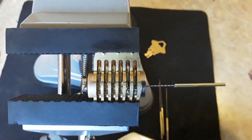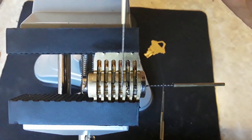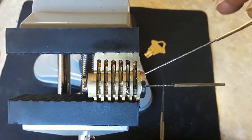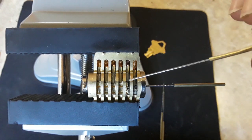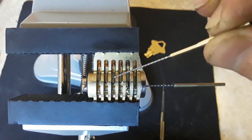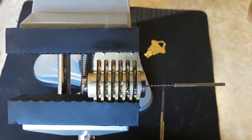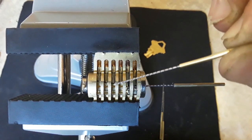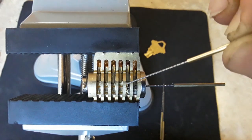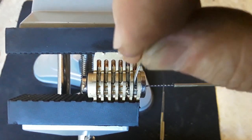This is very, very difficult to pull out. You can see right here we have a pin that has dropped down — we're going to have to deal with that. Right now we're just going to try to pull this back that little bit until we feel it stop. I can look through the front and see — I can actually lift one pin up and see if the other one has dropped. We could have broken off all the way back, and we'd have to contend with the pins in front. What I usually do is look in there, count, and lift them up until I can see the broken key.